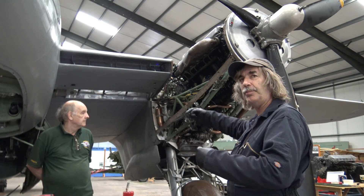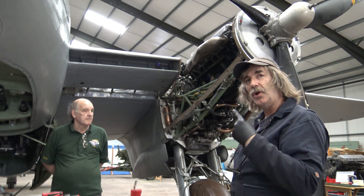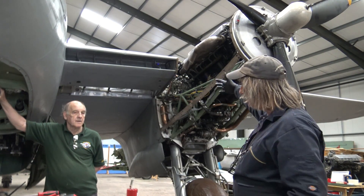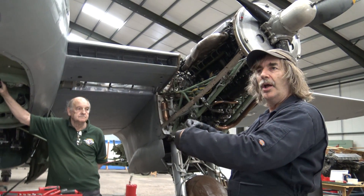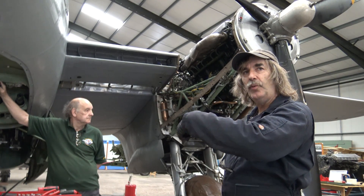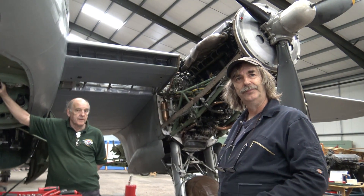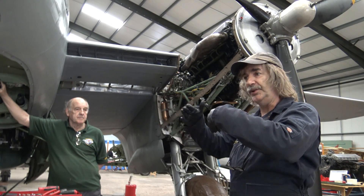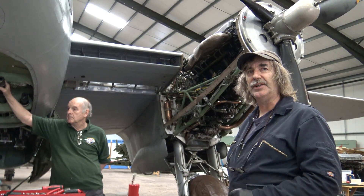The reason for the timing difference between the two spark plugs is their location: the spark plug on the exhaust side and the spark plug on the inlet side are directly opposite each other across the cylinder. The flame travel is slightly different because of the gas flow — the inlet valves are on the inside of the engine, the exhaust valves are on the outside, so the fuel/air mixture is constantly moving. The timing of where you want the spark plug to fire on the inlet side is slightly different from the exhaust side. They're just a little bit later — only a fraction different. The advance/retard curve is pretty much the same but the base timing is a fraction different.